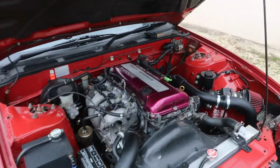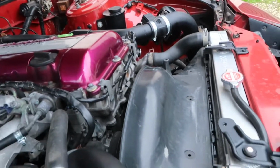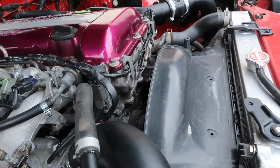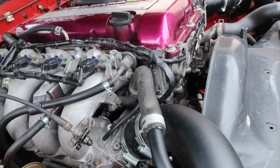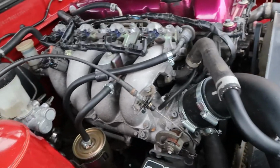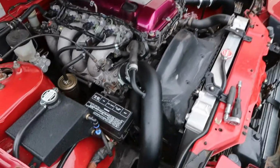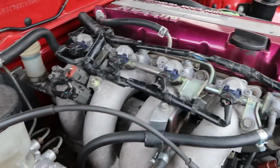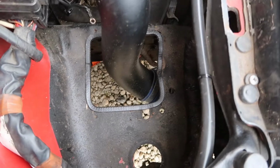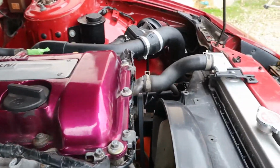And just like that, we have the engine wiring harness now on. There is a distinct lack of something that I've noticed whilst I'm here. We haven't got the gearbox wiring loom. The lower half of this I do not have. Also, for the more eagle-eyed viewers, you'll notice there's no battery on this. So I'm going to need to get a battery for this and relocate it to the boot as well, because there's just no room to put a battery down in there. Also gonna need to get the washer bottle fit back in there so it all fits properly.